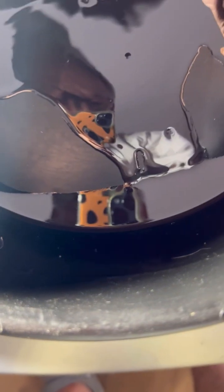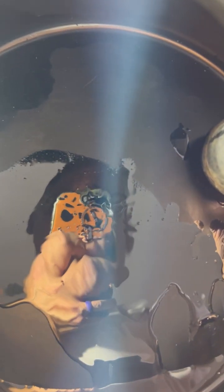There's not really that much oil in here. There's that little guy — the filter doesn't really hold that much, really. It looks like it's maybe just a third of a cup or maybe a half a cup. That's not really that much. So now the next step would be to pull the plug on the bottom and drain the bulk of the oil.